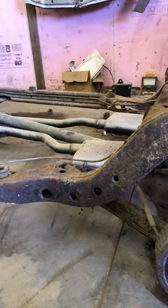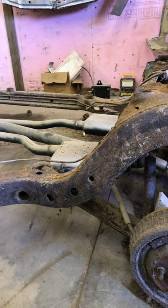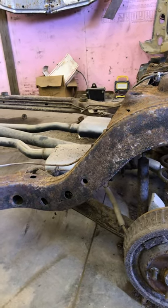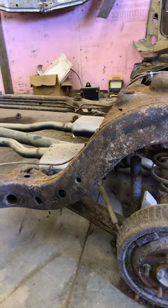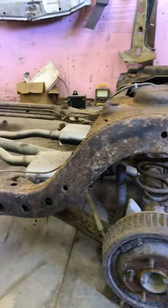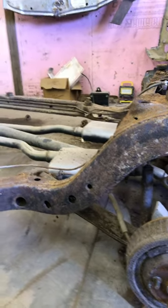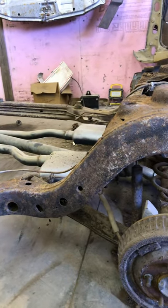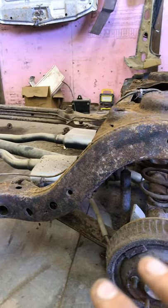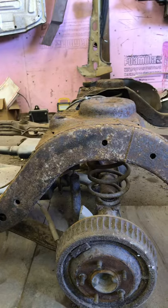There's no weight in the rear of the frame, so nothing is pulling the frame down. It's sitting on the rear end right now with the shocks there, so when I cut this metal out I'm not worried about the frame bending or tweaking. That's a major concern for a lot of guys — they get nervous cutting these frames apart worrying about whether it'll ever be straight again. There's always a possibility it could move, but these frames are really rigid, made to take a lot of abuse, and even though this one is in fairly bad shape I still trust the metal that's there.